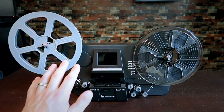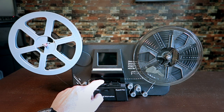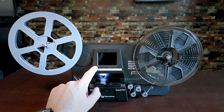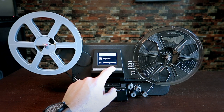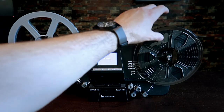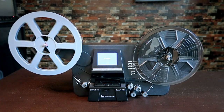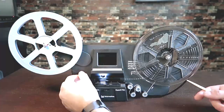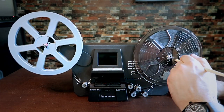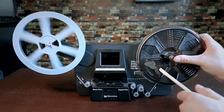Lastly, I will show you how the rewind function works. I switched the two reels around on the device, and this time you are going to follow the dotted guideline on the machine, avoiding threading the film onto the tray because we don't want the resistance. It will also miss and overpass the knobs, giving a clear pathway to the original reel. Once this is set, hit the power button, tap the menu, arrow down two spots to rewind, click enter, and it's going to tell you to remove the film from the light table — which we already did — then press enter one more time. I've noticed sometimes it gets stuck and you will need to remove the film from the first knob, then it starts moving steadily. I personally prefer to thread it under the first and third position and use a chopstick to manually spin it with the machine off. I find this method much faster, but keep in mind you are risking damaging the film, so please be careful. As you can see, I'm able to finish rewinding the film and I'm good to go.